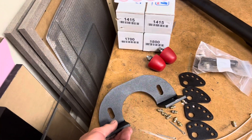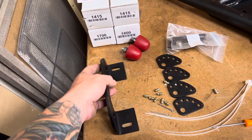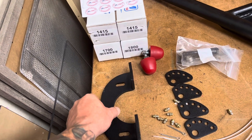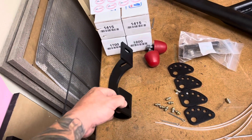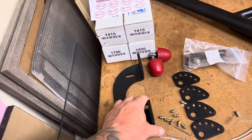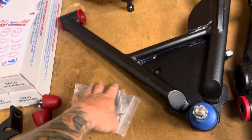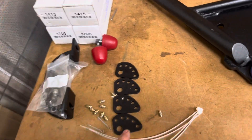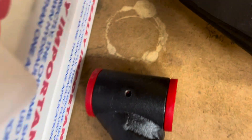The carrier bearing kit is to lift your carrier bearing up if you have vibration issues. I have a single drive shaft so I won't be needing this. I think they have two-piece drive shafts on crew cabs and extended cabs — I'm not sure, I just know I don't have it so I won't be needing to use this.